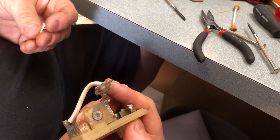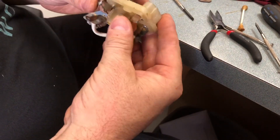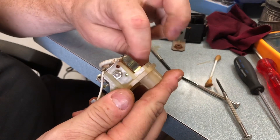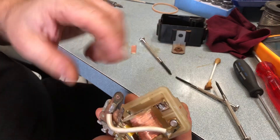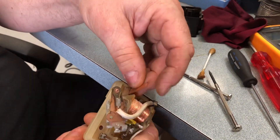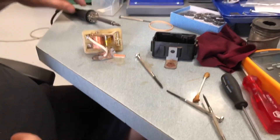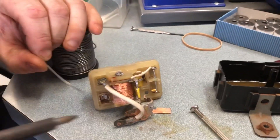Hopefully that'll be strong enough to hold 80 amps — well, 60 amps anyway, it's got a 60 amp line fuse on it. I'll bring you back once I've cleaned it up. I've taken a bit of a sand off that surface and this one too. Next I'm going to put some solder on this to prepare it for electrical connection, then we'll mechanically fold this piece over for a combined mechanical and electrical connection.